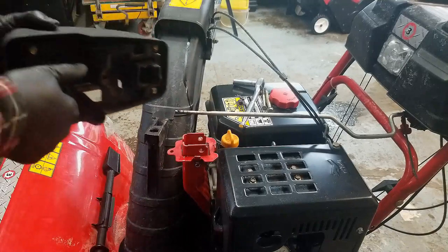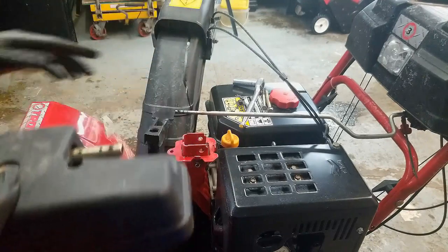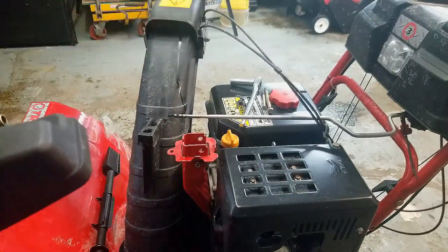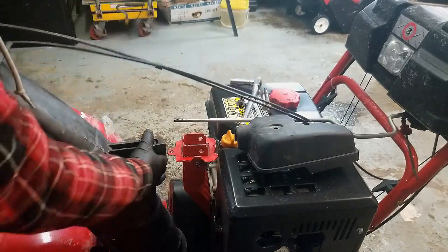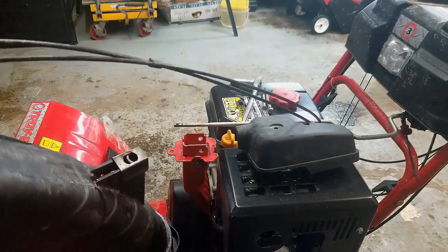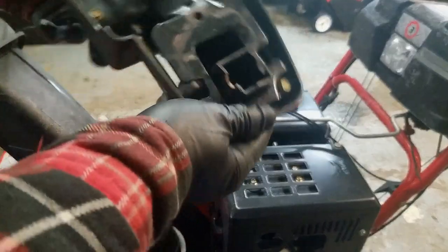Now what we're going to have to do is get into this motor a little bit, because this rod is free to turn from the motor end. The motor underneath here is not messed up. To turn the chute — the chute part itself looks fine — I don't see any issues with the chute itself. So the problem has got to be in this transfer case here.